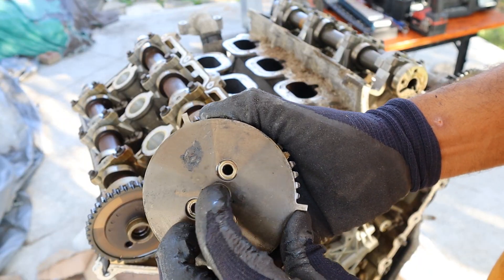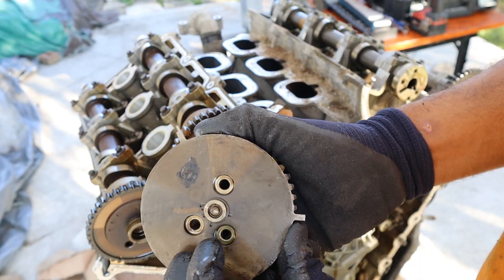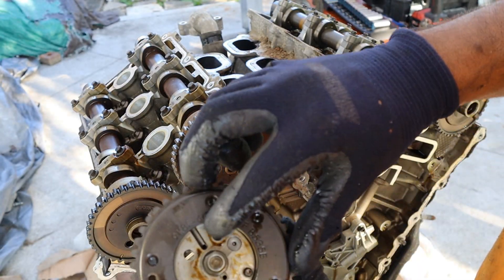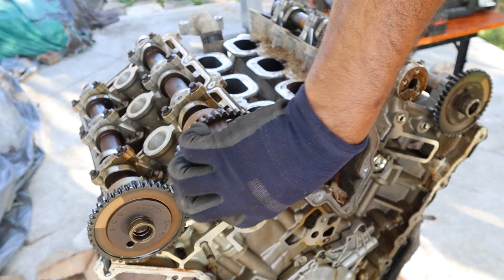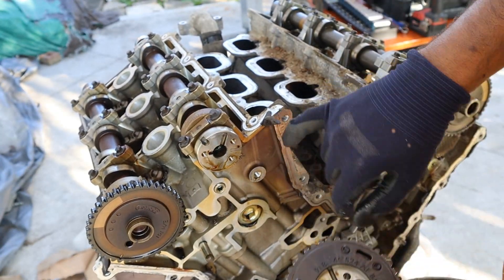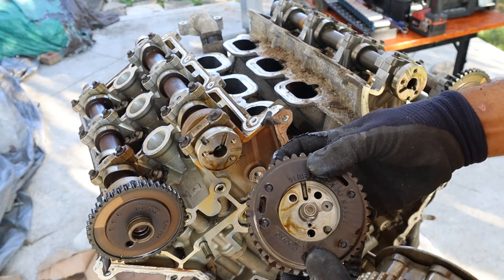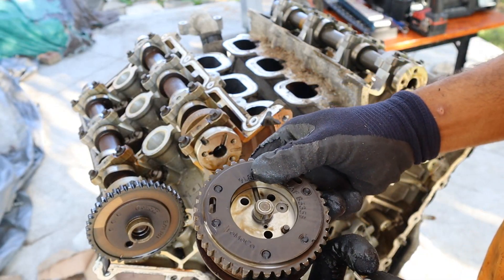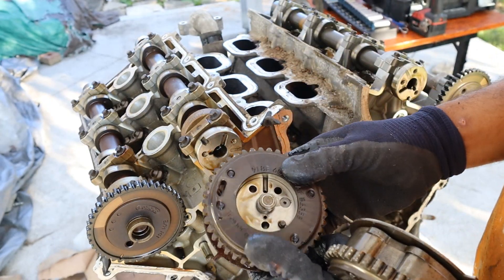It's got a little plunger inside. As we saw earlier, the actuator for the oil control valve is also a plunger, so it's going to push in on this piece. What that does is activate the oil passages inside here to fill up this gear with oil. Oil actually flows through the camshaft through these little grooves inside here, and it's just waiting on that plunger to push in in order to fill the gear and phase the cam timing. If you want to learn more about variable valve timing, I do have a video linked above.